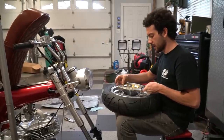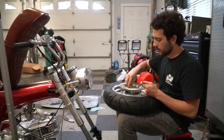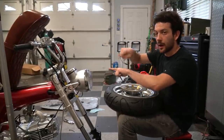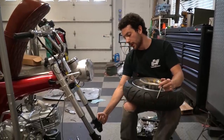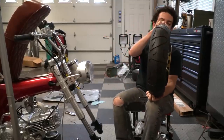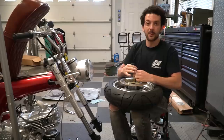Here's some useful consumer information: your forks and front rotor are going to show up in different orientations. Right out of the box I put the forks on and the rotor just like they came, and the rotor was flipped upside down and the forks were on the wrong way too. So if you're ordering the same kit, just know that your rotor should be on the driver's side — the bracket side — and the caliper mount and rotor need to be turned out so it's not flush with the wheel but actually poking out from it.